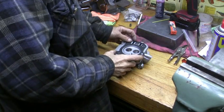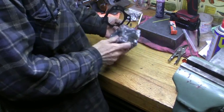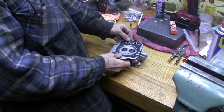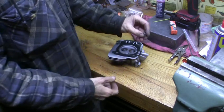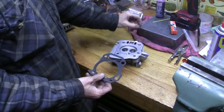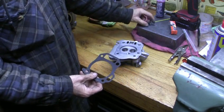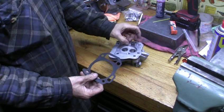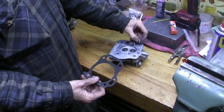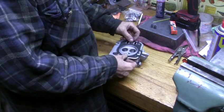What we have here is the Honda GX200 clone head, and it's imported. This is the Harbor Freight gasket, but you can see these are the pins for the GX which fit in there. These are the pins for the Harbor Freight — you can see the Harbor Freight pins are basically bigger, so we're going to have to drill these out.